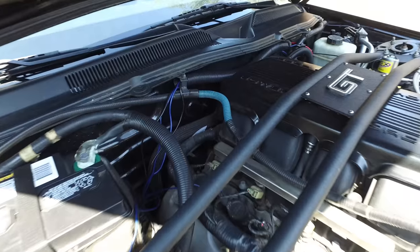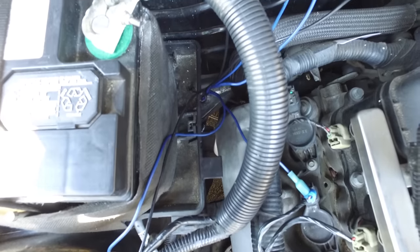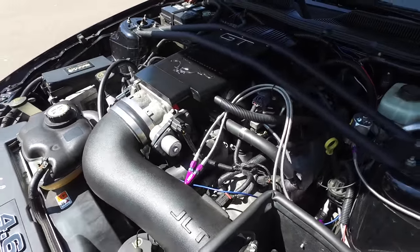Just to show you guys where exactly the wires are going through — it goes all the way down there. I also installed the zero degree forward performance spark plugs, which is a necessity for running nitrous. So Zex is a bit confusing when it comes to the numbers — usually 100 shots means an increase of 100 rear wheel horsepower, but Zex does it differently. Their numbers are towards the crank, so 100 shots of Zex is really 75 horsepower to the wheels. I don't know why they did that, that's just how it is. But I'm totally fine with that because this is my first test run and I don't want things to go out of control. In the future I will upgrade to 125 shots for Zex so I can have 100 horsepower to the wheels.